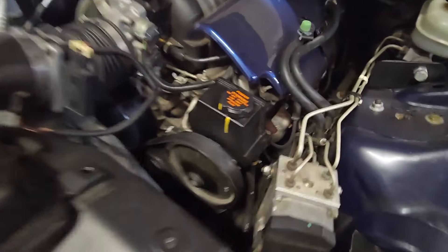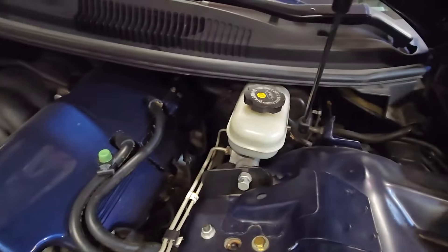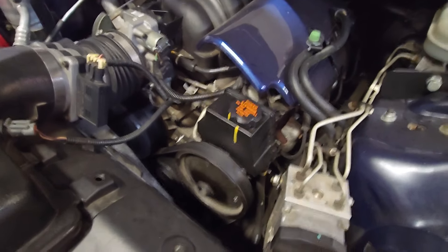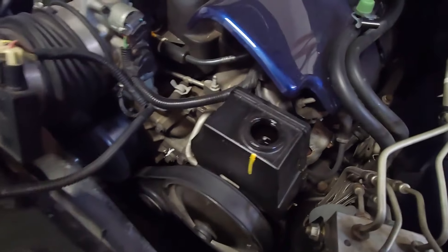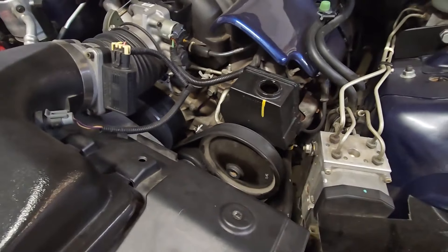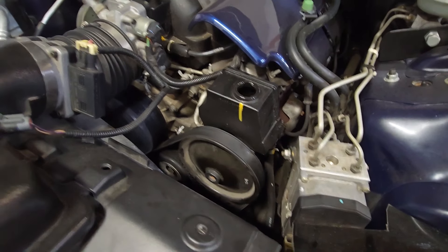I want to try and change out some of this fluid — you'll never get it all out, but the nice thing about the power steering pump is it's constantly circulating. Unlike the brake reservoir where fluid at the rear calipers mostly stays there, this fluid is constantly cycling. So what I'm doing is every day for about a week up to the install, I'm going to take my suction device, pull out all the fluid I can from the reservoir, refill it, drive the car the next day, and repeat. The new fluid will keep cycling with the old — it won't be perfect, but it will get a lot of it out.